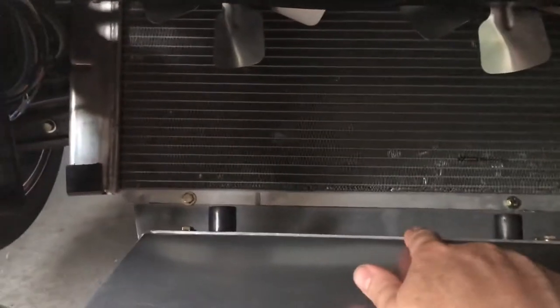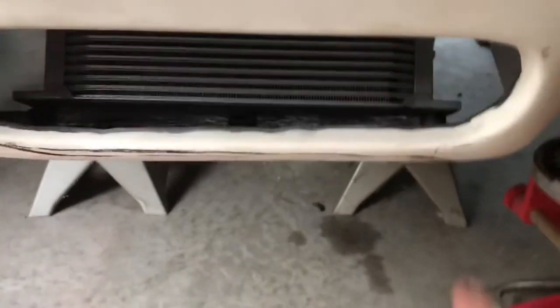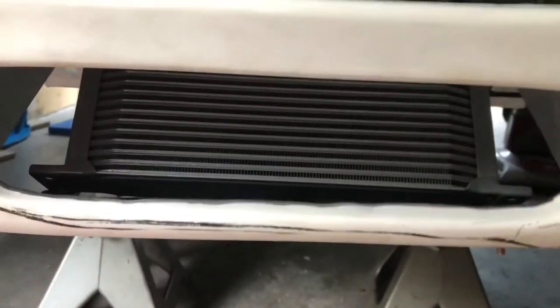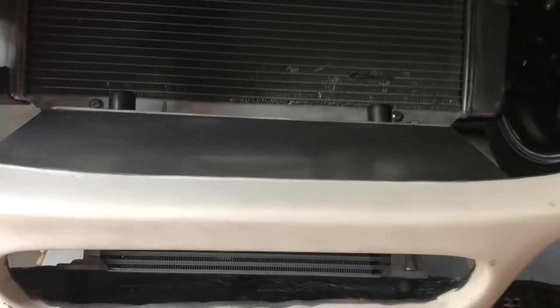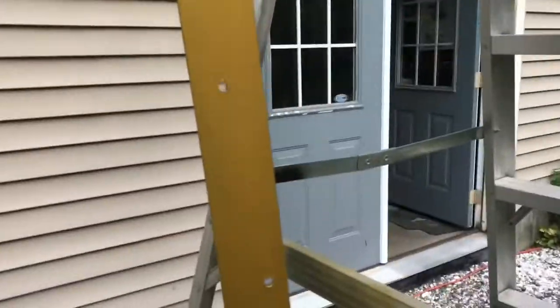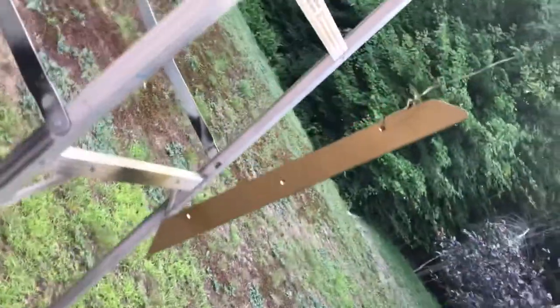Alright, I'm done with this portion of it. You can see the piece I fabricated from the road sign — came out very good, like I wanted it to. Had this thing all bolted in place with some rubber spacers down here to kind of make up the difference. It's a six-inch oil cooler but it's mounted on the bias, on an angle, to increase your surface area — same as the radiator; it makes perfect sense. The bolts are sticking through at the bottom and we're ready for the skid plate. I have the skid plate made and painted — I got cute and used some Hertz gold spray paint. It didn't come out that great because it was trying to cover black. You're never going to see it anyway — just a little skid plate protector to protect the nose of the car.